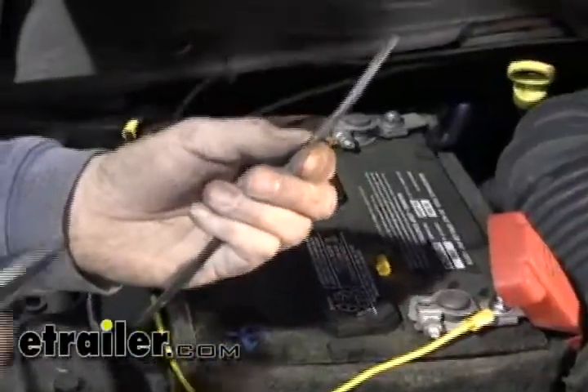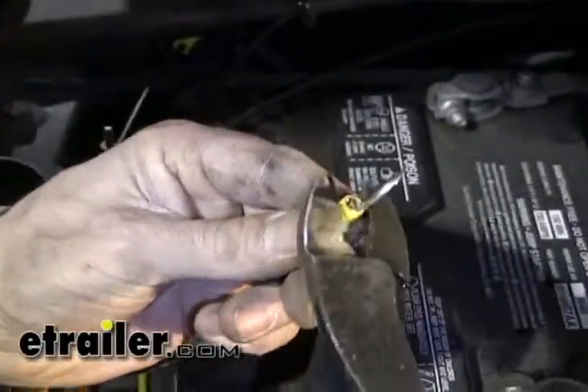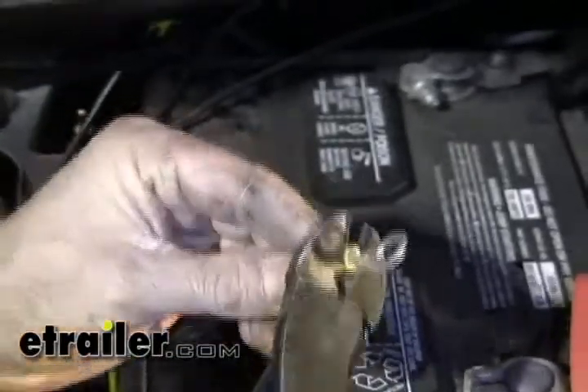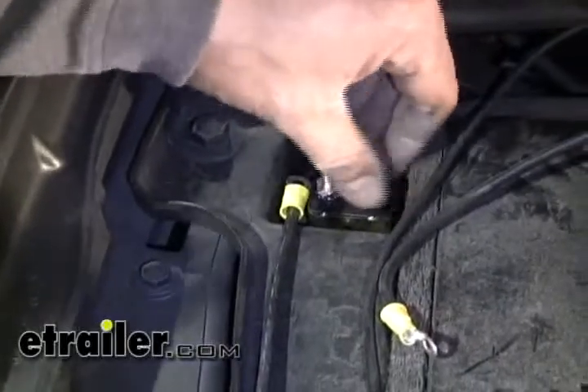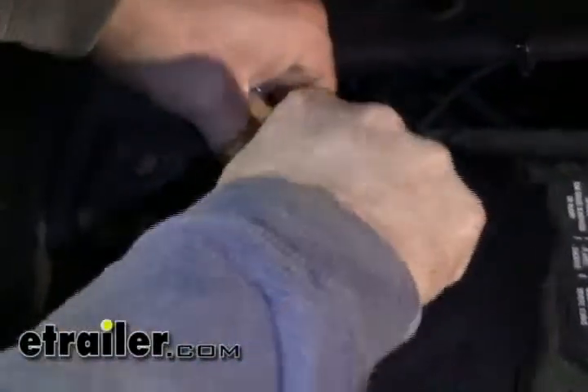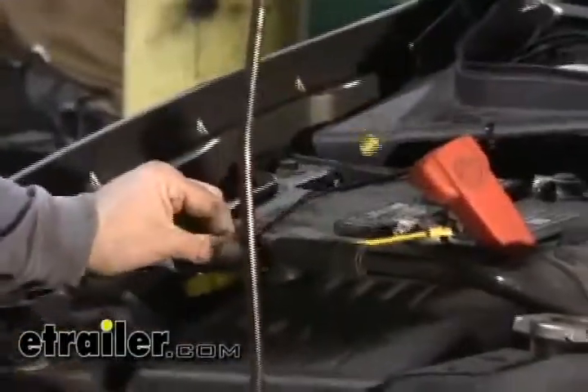The other half of this wire we'll go ahead and cut to length as well to match up to our terminal on the positive side. We'll add a ring terminal to that — that'll be one of the larger ones. We'll go ahead and hook these up to the circuit breaker. For the output going to the 12V power supply, we'll use the silver post. And the wire going out to the battery, we'll be using the copper post. Our connection going to the battery we'll actually save for last.